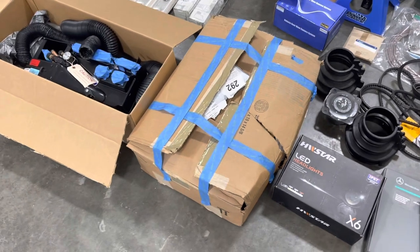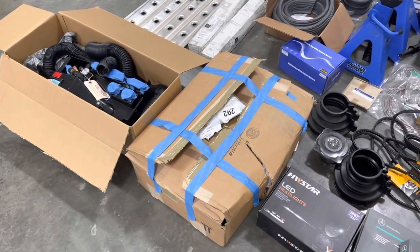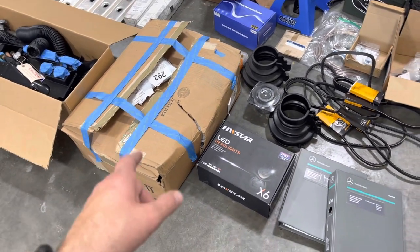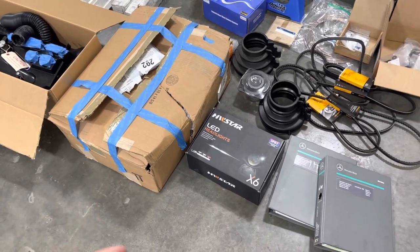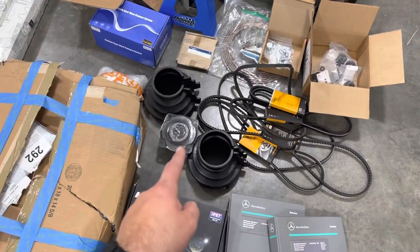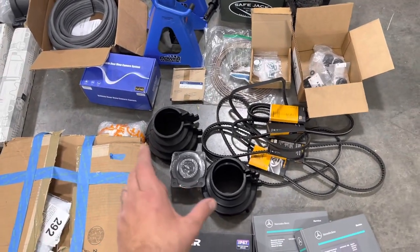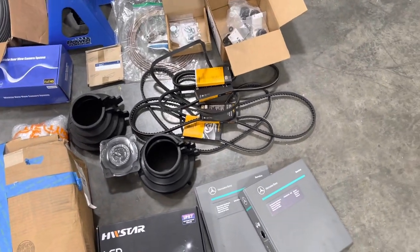It's a full kit. We have done it before in an older truck, and we called Vintage Air, and we worked with them and pieced together an entire kit for it. So that's ready to go in there. You'd have to make a bracket for the compressor, and you'd be good to go. We got two cab mounts, two torque tube boots that need to go on, so I haven't had a chance to install them.